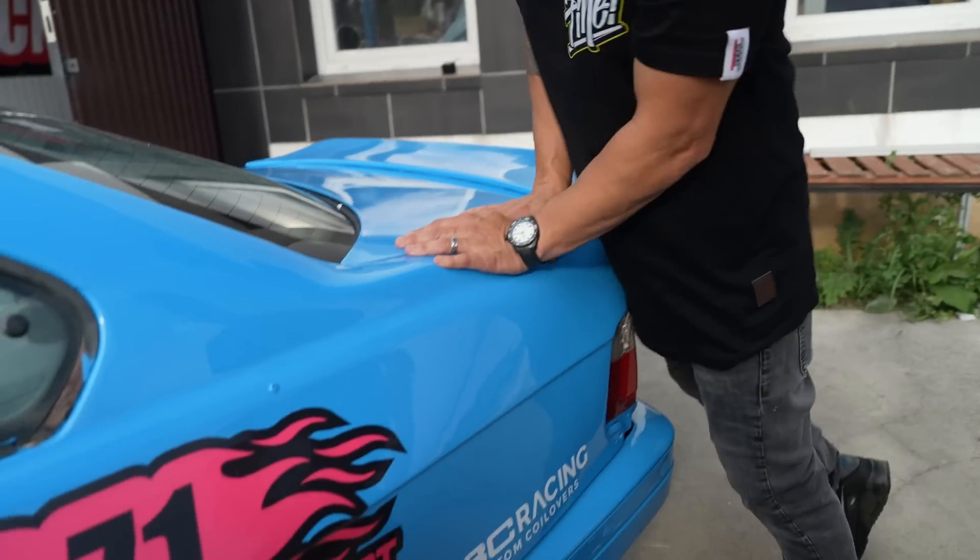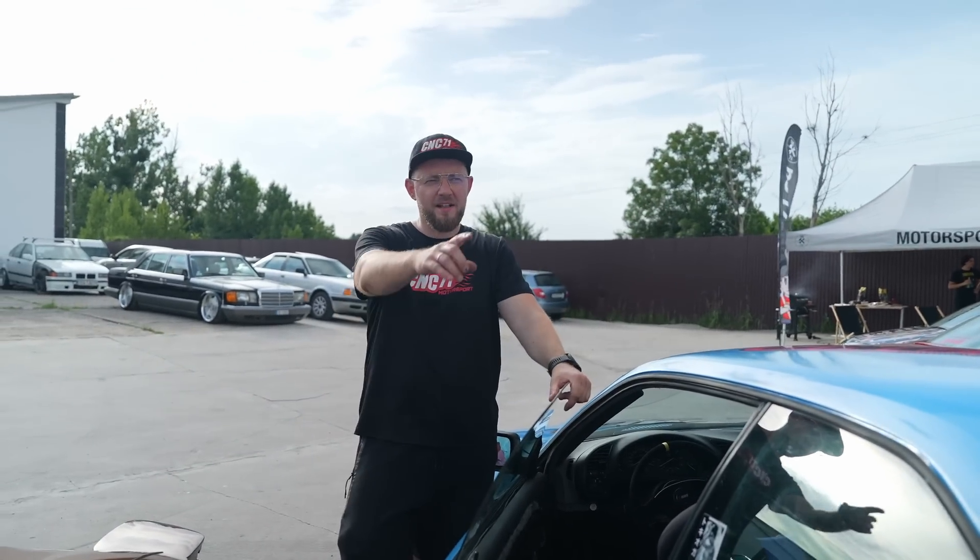It rips actually — I've been testing this car at our local track with the very same spec, we changed nothing. It rips in third gear. What diff is in it? It's a 3.45, because in about 90% of Euro-spec E36s it will be a 3.45, except for M3s and diesels. It's the same M50 B25 as the ones we did at the compound. Most of them rip if you put the right gear in with a good clutch. If the clutch goes, we have spares — Michael can change a clutch in 15 minutes.